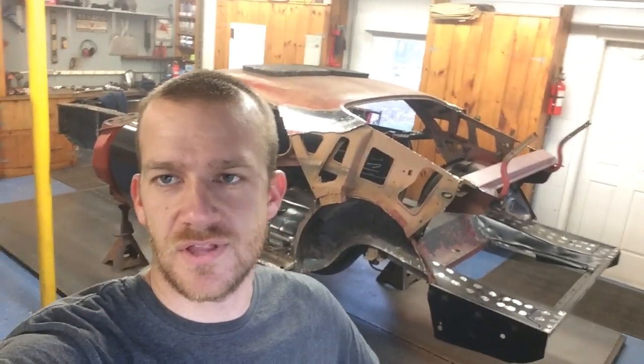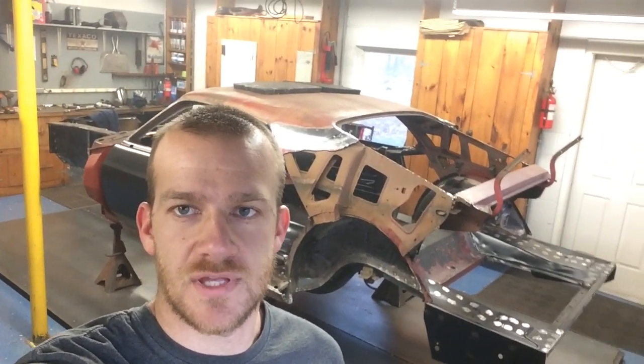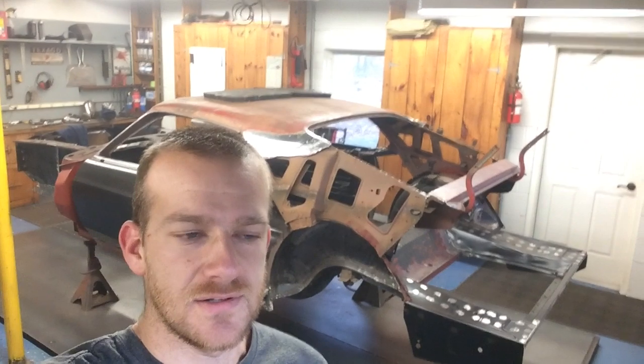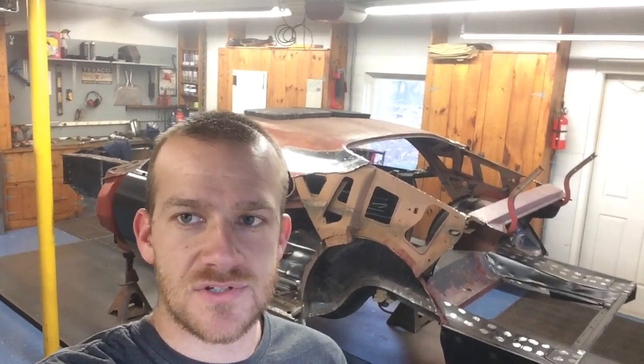If you liked it, give it a thumbs up. Basically we're prepping for the new quarter panels, removing all the old pieces, prepping all the surfaces to weld to, and we'll clean and paint all this inner structure so nothing has any issues in the future for this car. Then we'll attach the outer wheelhouses and weld everything back together. Moving along pretty well. Don't forget to subscribe — I should have another video tomorrow. Everything should be prepped, all that inner structure painted, and by the weekend be ready to set the quarter panels, taillight panel, and line everything up before I even weld. It takes a couple days — a lot of adjustment to get everything right. Thanks for watching.